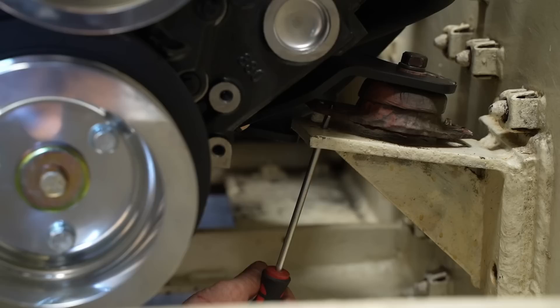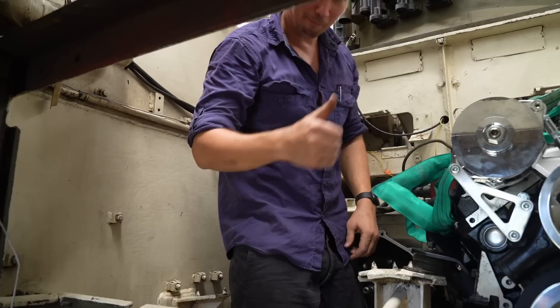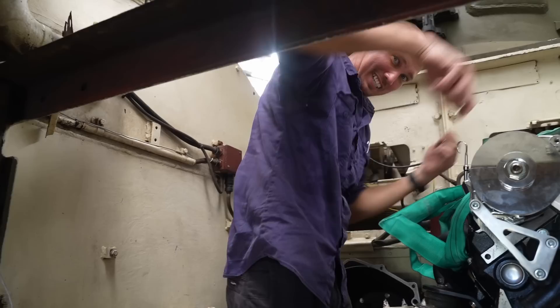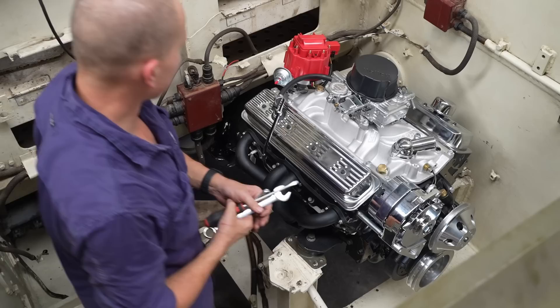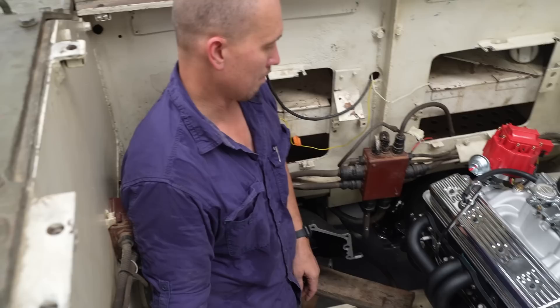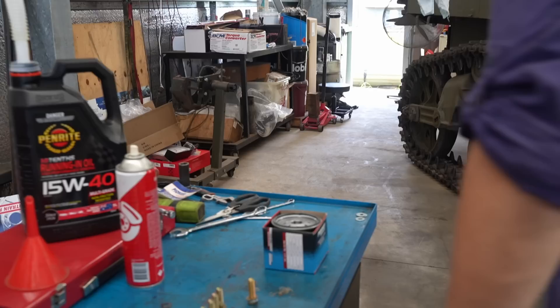Just come down a bit — that's it. Got him! Getting the other one in is going to be tricky; you won't have any room and you'll have to lay over the top of everything. I'll just get the rest of these bolts in — ready for the next one. The only thing we've got to do is put the engine mount bolts in, but it's sitting in there nice. It's got these little locators so it's not going anywhere at the moment. Time to finish off and fit engine two.